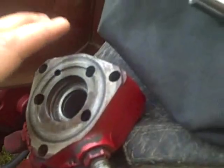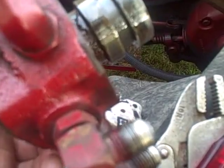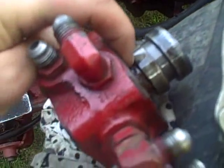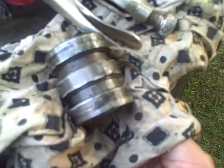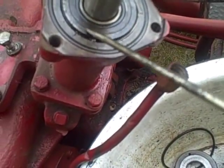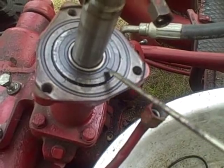This cylinder is a really tight fit but I'm tapping it out slowly and it's coming out. More contamination problems inside this spool — I just knocked it loose and you can see contaminants in there. It looks like rust, probably from water and hydraulic fluid that sat in there. I was able to clean the heaviest crud off and we'll see how bad the parts are when I clean them with solvent. I stuck a screwdriver in here and sure enough the inner race for the bottom bearing is wiggling around — so the other needle bearing is going to be underneath here.